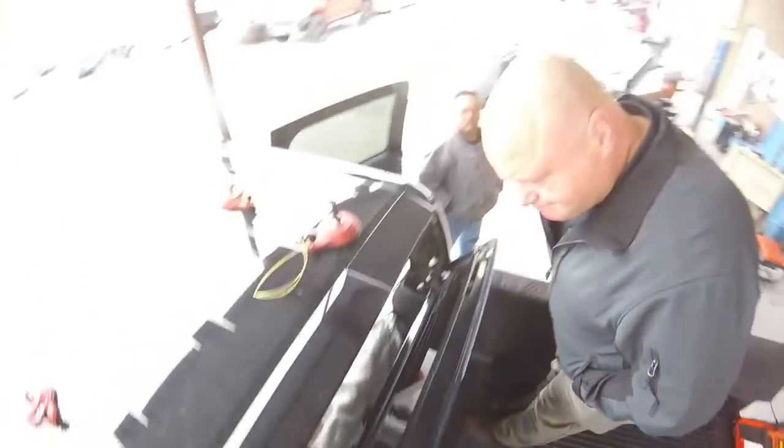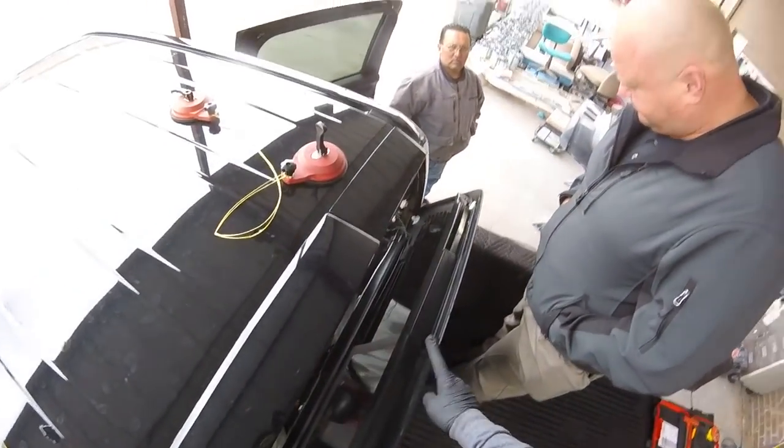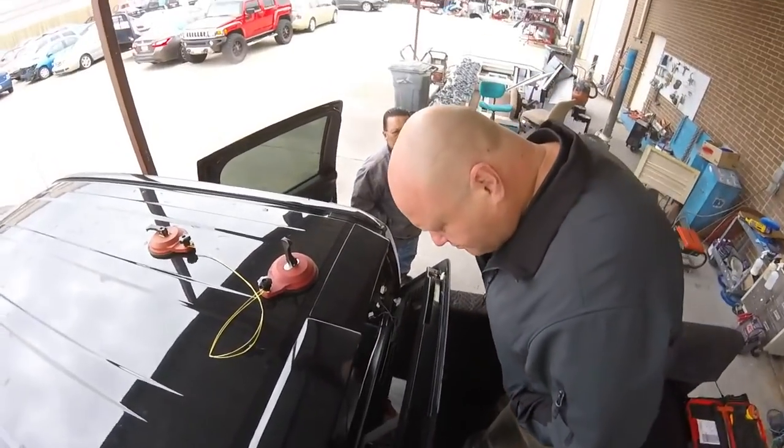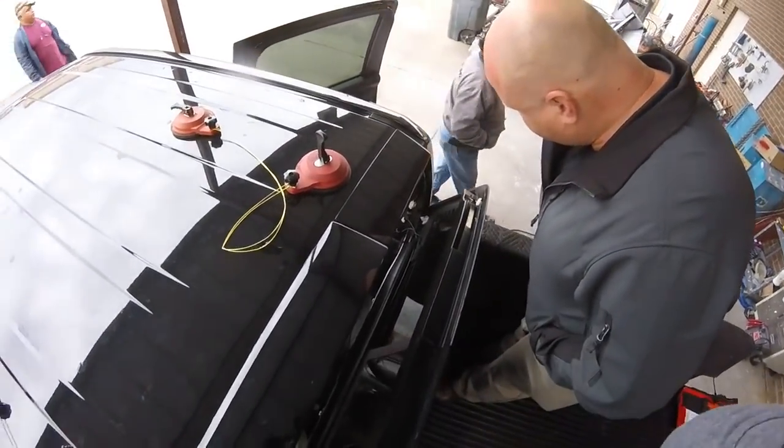Like this primer. Yeah, all of them. You see? This is a delamination problem with the plastic. Every time before we put this one, we have to clean very good, encapsulate, and put the primer. Wait 3 or 5 minutes, depending on the brand you're using.